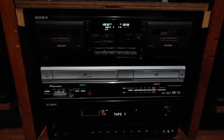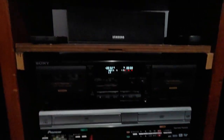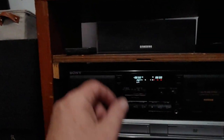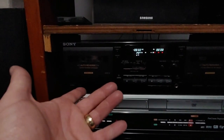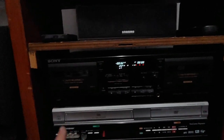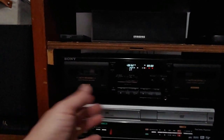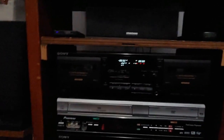The cassette deck is back where it belongs. We picked this up at an estate sale - this receiver had nothing wrong with it, and the cassette deck and TV too. He loved the TV - he had a flat panel but wanted this old one to run his games through. Anyway, I recorded some YouTube music on this deck - it's got clean heads, new belts, and clean rollers. I put several samples of YouTube music on here so we can go through the auto music search and see how well that works. I recorded it in the B deck because that is your record deck.